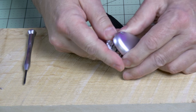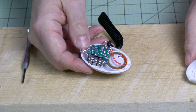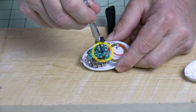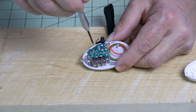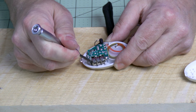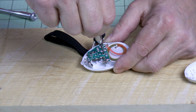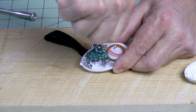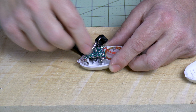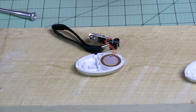I got in there pretty quick. We no longer need this ring — we can set that aside. You can see the circuit board, and there's a small screw in the circuit board right in the center here. We need to remove that screw so we can get the circuit board out. First I'm going to pop these batteries out so that we don't have an unpleasant experience. Use a smaller screwdriver — these are like jeweler's screwdrivers. That screw is very small.